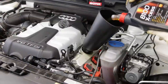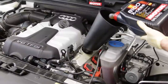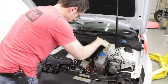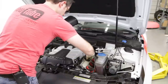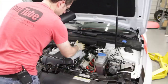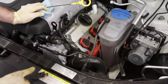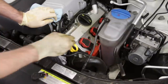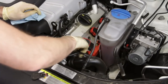I'm going to dump all the oil in — about six liters to start — then I'll unlock the funnel and throw the oil cap back in place. Start the engine up, because when you check the oil you need to make sure it's run through everything including the filter housing. There's a plug here where your dipstick could go if you had one — we'll link to ours in the description. Stick the dipstick down in and check — it looks like we're going to need a little more.